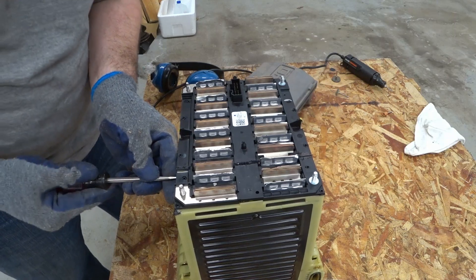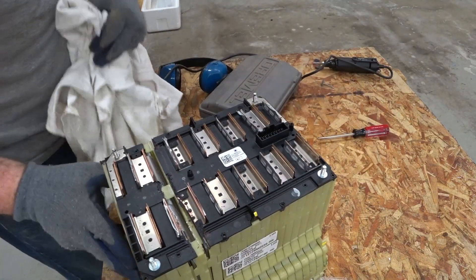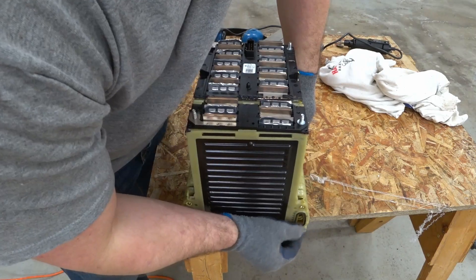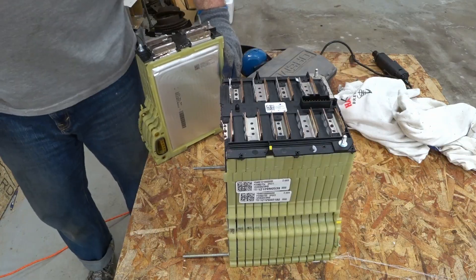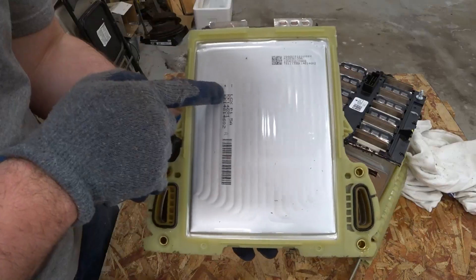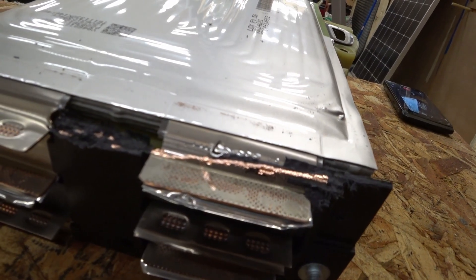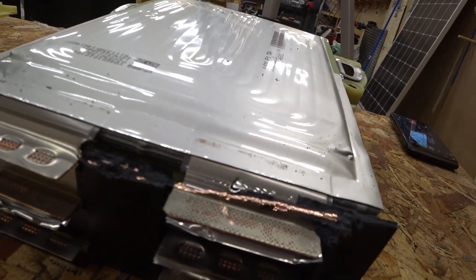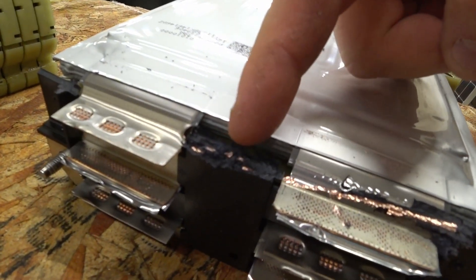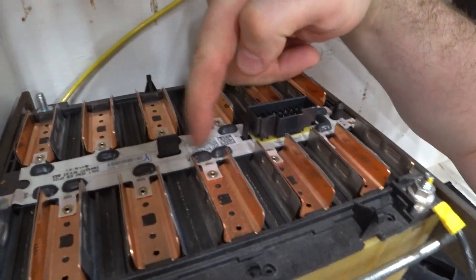Looks like I'm still hanging on by a hair — you can actually see the little copper leads in there that I was cutting through. Chevy embedded the copper wires for the BMS. Looks like I finally broke through with the Dremel tool. LG XP150 — what a bad idea this is if you are thinking about doing it yourself. Even taking quite a long time, I still nicked the tab of the pouch. Over here in the middle you can see where these copper leads are embedded in the plastic for the BMS — quite different from the printed circuit board on the other side.